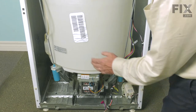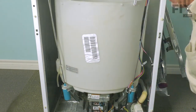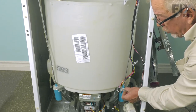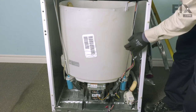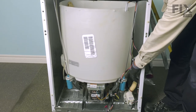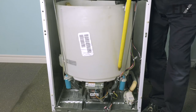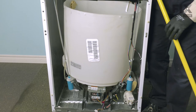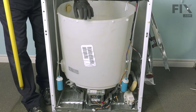Our next step will be to pull that air dome tube off of the outer tub and just let it hang there. Then we need to release the tub from the suspension rod holders. We need either a broom handle or an object that's at least two to three feet long so that we can pop those rear ones out easily. To remove the four suspension rods, basically we're going to remove the weight off of them by lifting up on the outer tub. Then using a broom handle or similar object, we're going to knock this little bushing down through that metal piece. Once you've knocked that loose, you can pull the suspension out of the mount. Do the same on all four corners. Then let the whole assembly sit on the base. Do the same in the rear corners.